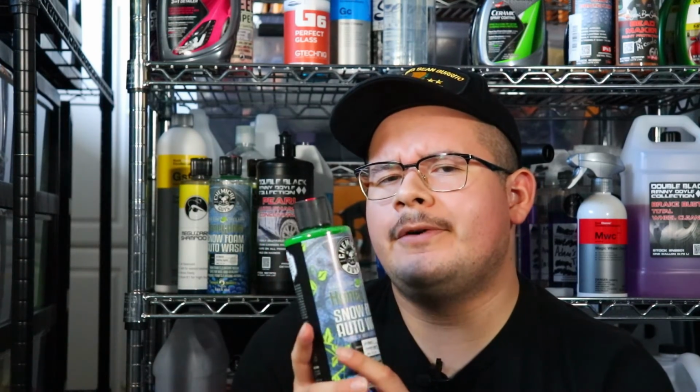In terms of what dilution you should be using, I think in a foam cannon 16 to 1 is the sweet spot. Diluting it even more, I think you start to lose a lot of foaming capabilities as well as the slickness because it just runs off a lot more since there's more water added.